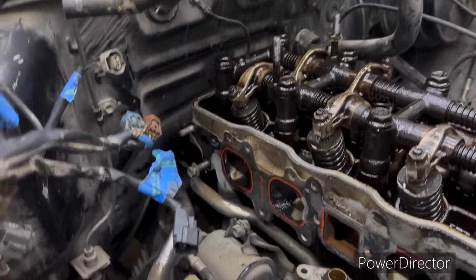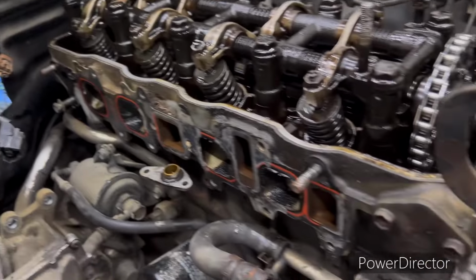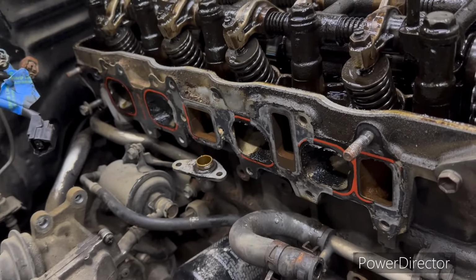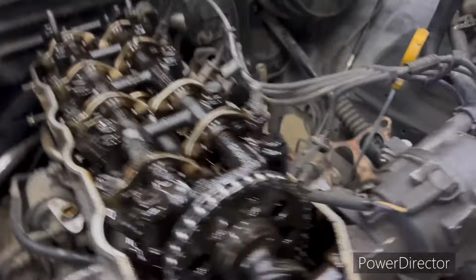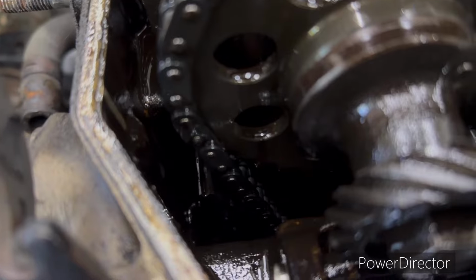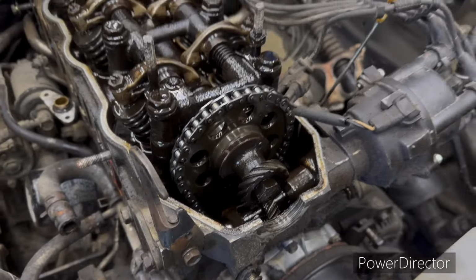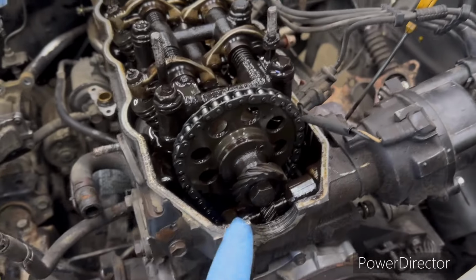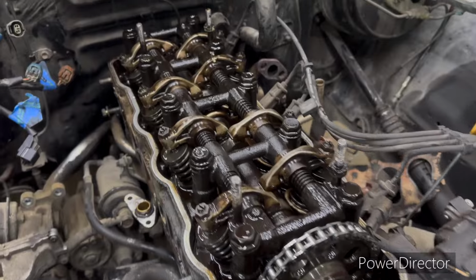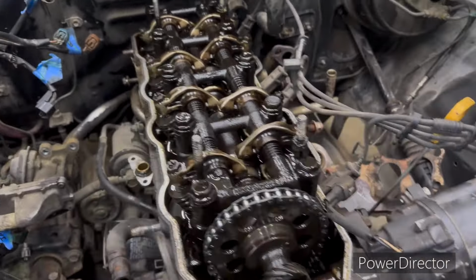We've got the rest of the intake off. I'm gonna go ahead and throw this out there. These bolts in places, you about got to be a doggone contortionist to get to, but we've got it off there. I'm gonna go ahead and take the head bolts loose. Well, timing chain and all, it doesn't matter. Everything looks good down in there. It doesn't look like it's got any slack, felt down in there with the screwdriver, but it's gonna come all apart anyway. So I'm gonna go ahead and take the bolt out. Just pull the gear forward on that. I'm not going to worry about that. We'll get it all back in time later. Take these head bolts loose and go ahead and get this head up out of there.